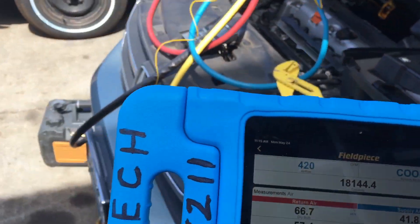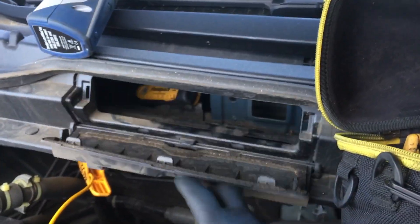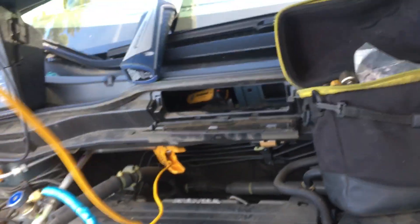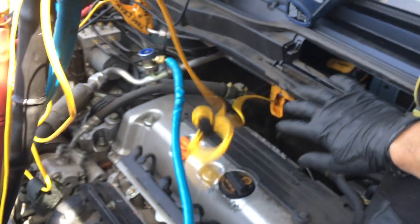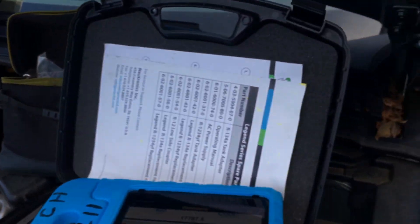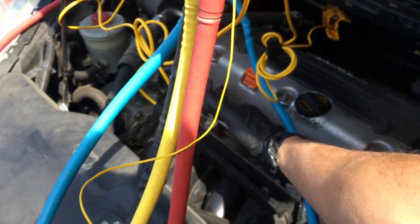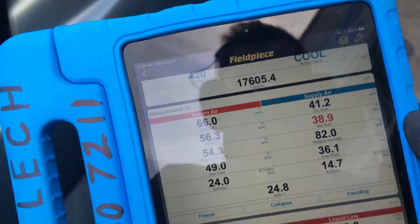This shows the actual temperature, not the temperature of the outside air. I opened this up and have the tip of the air probe way down in there, right on top of the air box where the filter takes in the mixed air. It gets the complete air temperature mix of the hot air coming over here being sucked in, plus the cold air from out here. That mixture of roughly 100-degree air plus the cold air comes out to 65 degrees going over the dash.